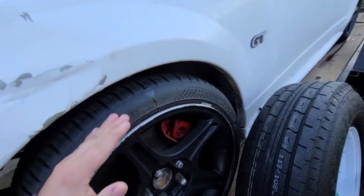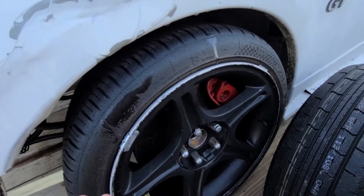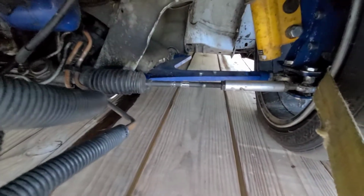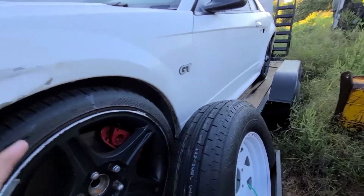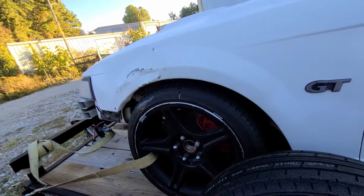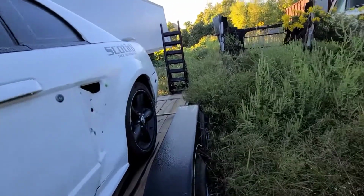It is also a drop knuckle. It has a ton of roll center correction to help with scrub radius and stuff like that. Has adjustable Ackerman, like I said. Yeah, just an insanely good kit. I tried to spin this thing out, and eventually I was able to, but you have got to chuck this car to be able to spin it out.